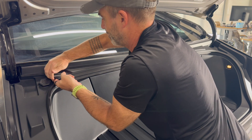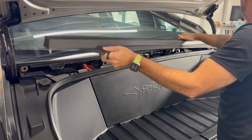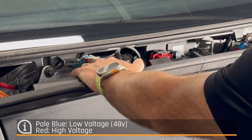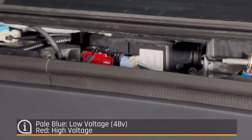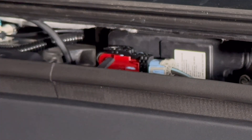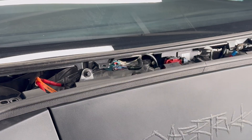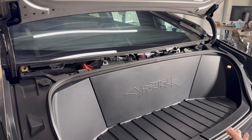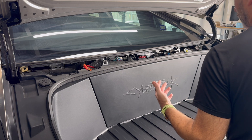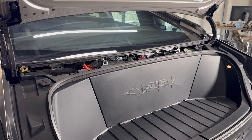In here you've got the 48-volt low voltage connector and then the high voltage connector. The way to do a master reset is to disconnect this first — the light blue — then disconnect this — the red, which is the high voltage — wait five minutes, then reverse the procedure: connect the high voltage, then connect the low voltage. The service center said that's all they did to get into the truck, so obviously it worked for them. I'm not going to recreate that right now because the thing's running and I don't want to screw it up again. But if you happen to be on the side of a road or broken down somewhere, that's how you do a master reset of the electrical subsystems and that should re-sync it. Hope this is of use to someone — thanks for watching.